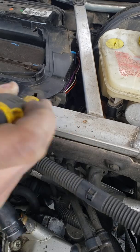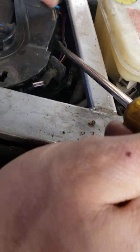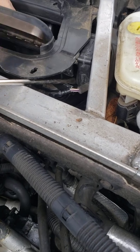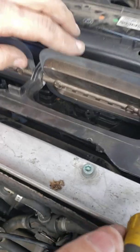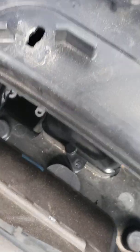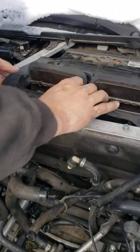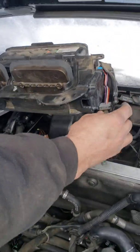You can take it, have the little things off, and it comes out just like that. So when that happens, you can actually see right here. Point your camera this way. When you remove that motor piece, you can move the flaps down a little bit, and there's actually 3 bolts right there. Where are they? They are right there. So one there, and one in the corner. Once you remove those, grab the camera, you can take this whole piece out completely.